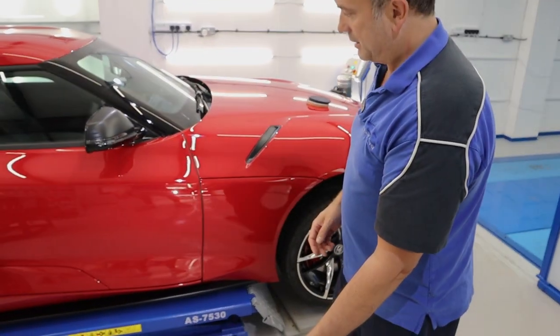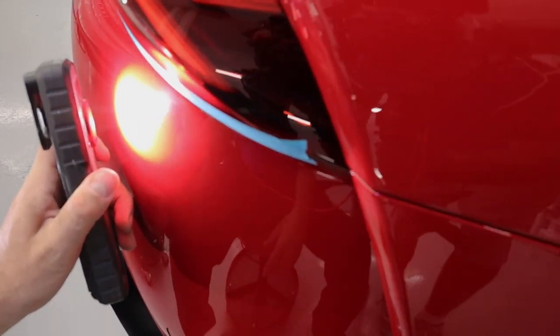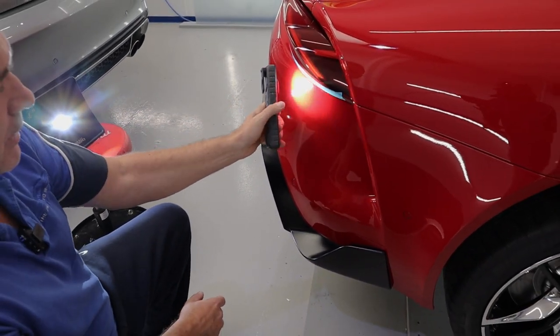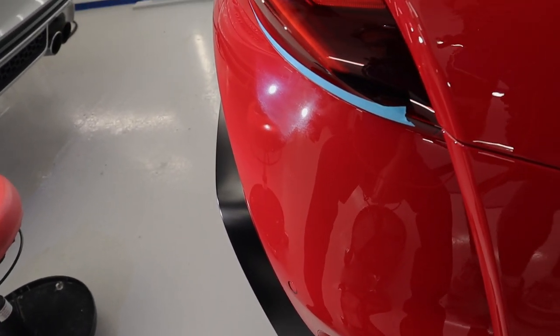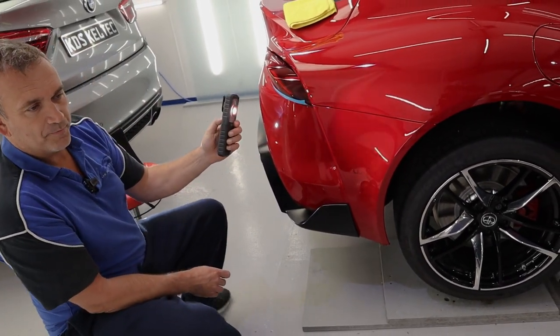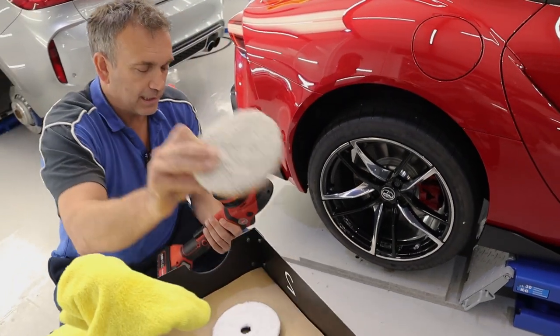The sun is millions of miles away — it's not really close. So we look at it with sunlight like this. What I don't want to do is get in really close and flood that. As soon as I take that light away and the light source is further away, as we get closer and closer it starts to flood. We have different types of light sources, different kelvins, different lumens for different purposes. I see so many YouTubers and detailers posting up work where they take the light away — it could just be trickery. You don't want a light source close. These head torches that you can strap onto polishing machines are a waste of time because they are actually masking the defects you're trying to polish.